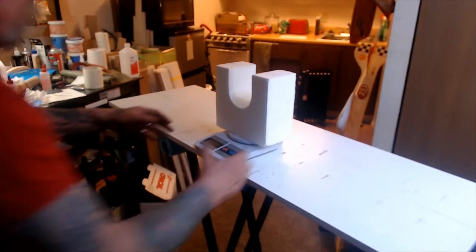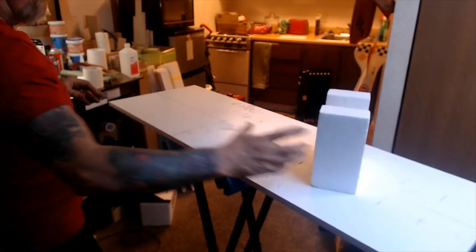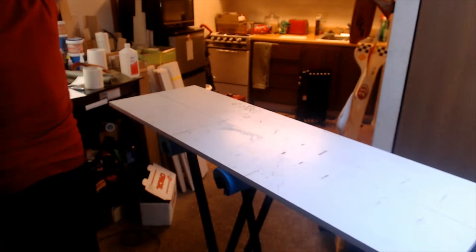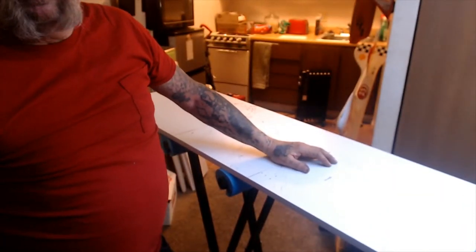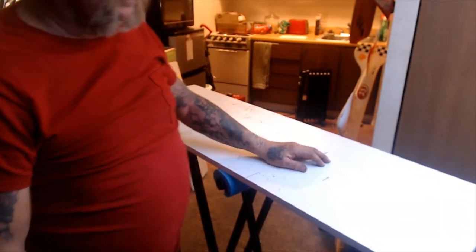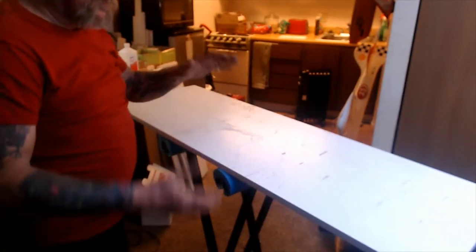You can't build light airplanes without light wood. I can tell you that right now. But the biggest killer is the paint. Everybody's looking for that magical 20-point finish with a shine that's 3 foot deep. And shoot that urethane on there, and I'll guarantee you that whatever you mix in that cup, whatever that cup of paint weighs, that's what it weighs when it hits the airplane, because it doesn't gas off.